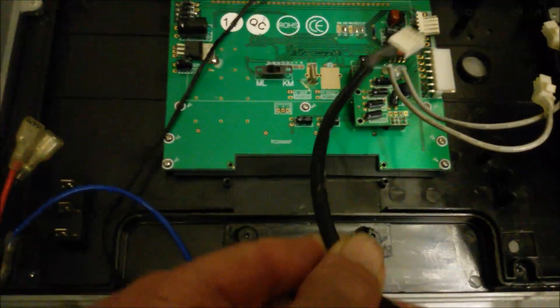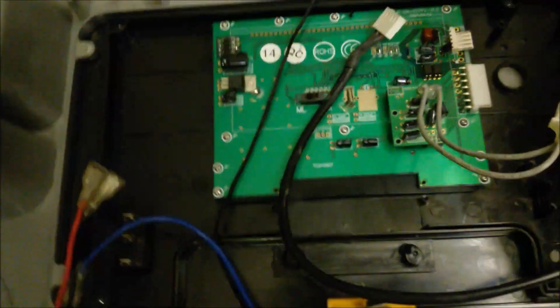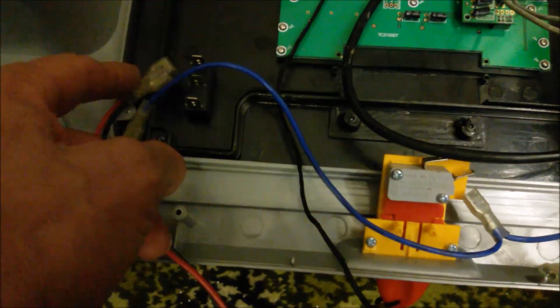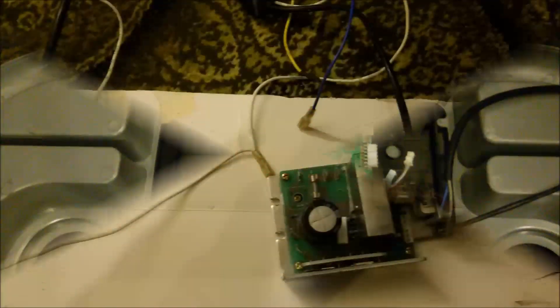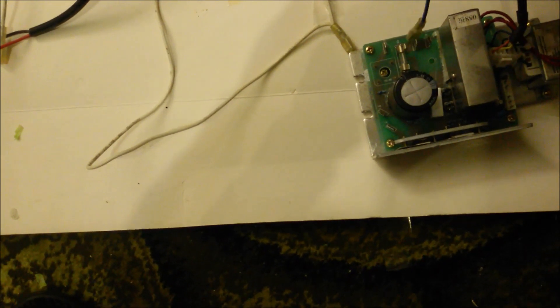The other thing up here is simply the control board. The control board has a multiway connector — those are from the pulse meter, the pulse meter connector. So that's the multiway connected to the control board and display at the top. The main thing I wanted to remember was red and black switched from the live: when going up it goes to red, when going down it switches to black. And that's the cutout switch. Here's that blue wire coming down from above.